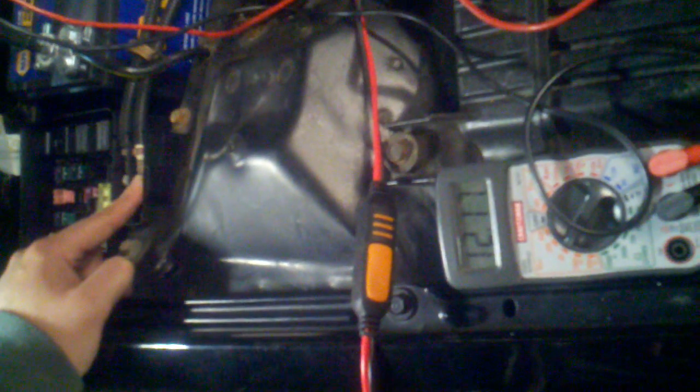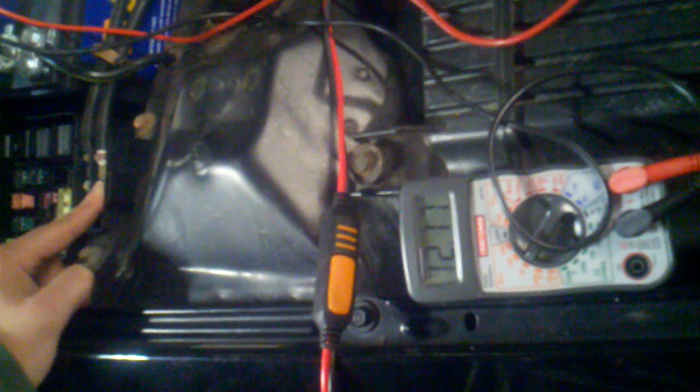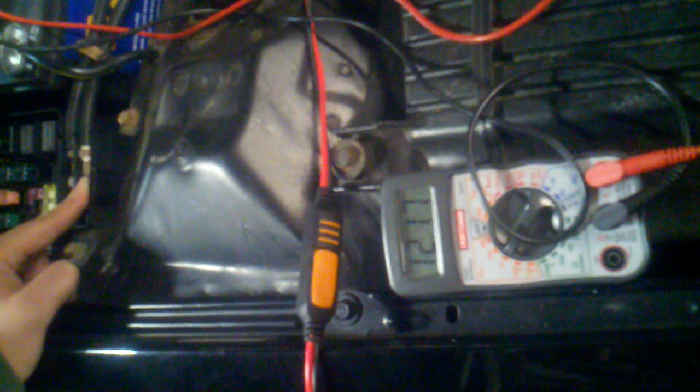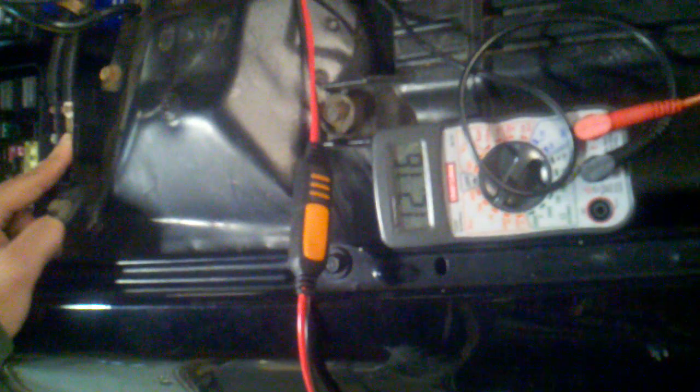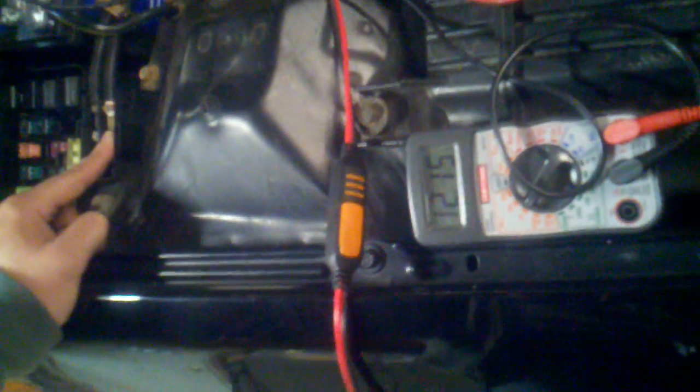It started at 12.42, and there might be a slight drop to account for the wiring we added to the system for the alternator to run, but it shouldn't keep dropping like this — that's the weird part. We're going to record this and see if it continues to drop. It just went to 12.16, now 12.15. The plan is to disconnect the alternator — not only this wire but also the green plug typical for all Honda alternators that goes into the side of the unit — and leave those disconnected all night with the battery cables still hooked up and every fuse and relay in the system, then see if the car starts in the morning.